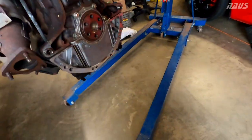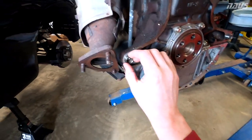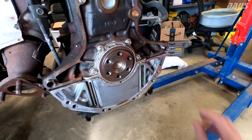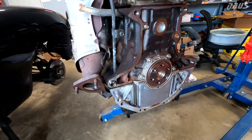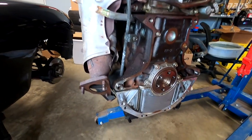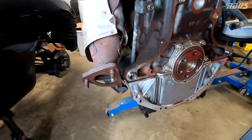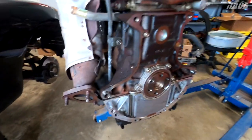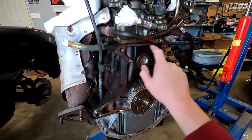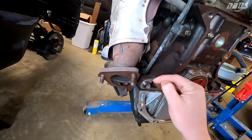What I plan to do here is use these two rear dowels that align the transmission. They're pretty thick steel, and a lot of people online say they don't really come out very easily, so I'm not going to mess with it. That's why I have the aluminum washers. I'm going to put an aluminum washer between the steel cylinders on the engine stand and the steel dowel, so if there is something that needs to be sacrificial, crushing, it could be the washer. And then I'm going to put three washers each up here just to space the same thickness that this sticks out.